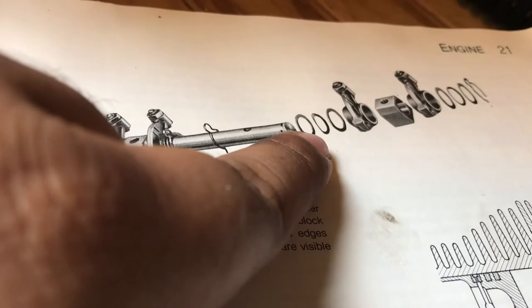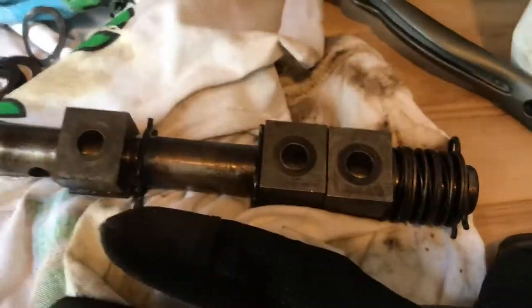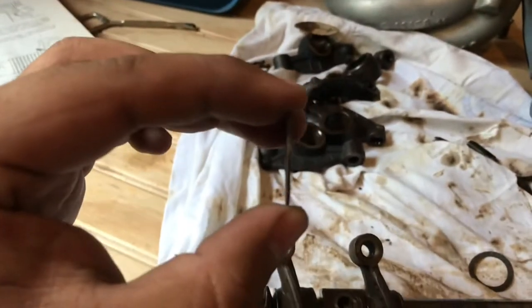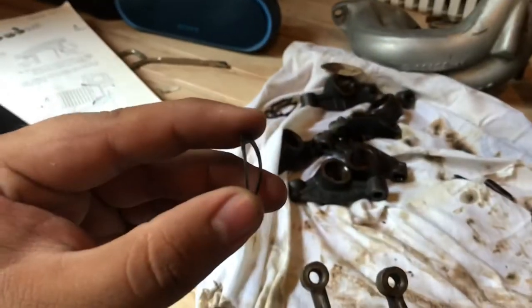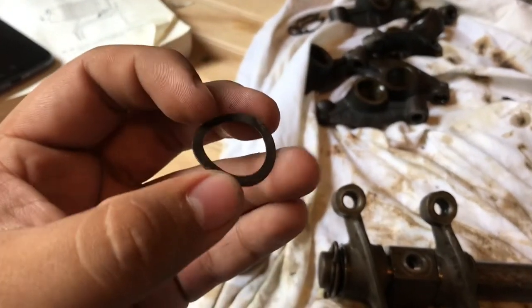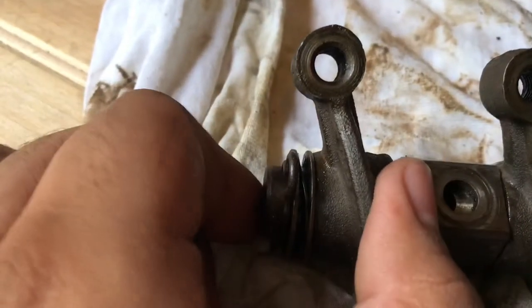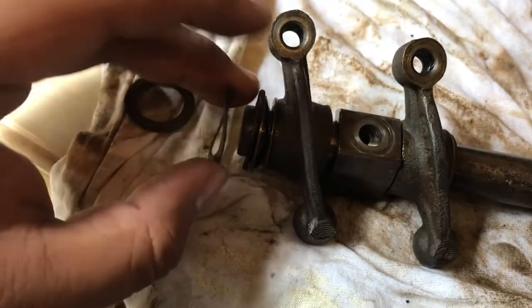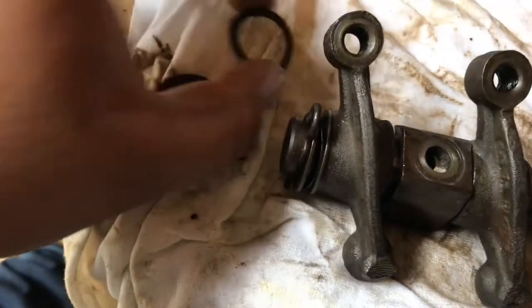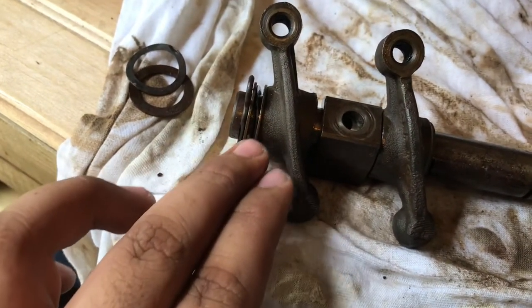But just in case you don't really get the diagram — you can see this middle washer here is very much different than the two on the left. It looks kind of warped, and that's because it is. On the other rocker arm I just got them all together like that. Basically the order is: it's the regular straight washer — one on each side — but sandwiched in the middle is these bent ones. These are meant to be bent like this. Do not bend these back because they are actually meant to be this way. They kind of act as some kind of spring. They face so that they would compress like a spring, and you'd put: regular washer, then the spring washer, then back to regular washer.